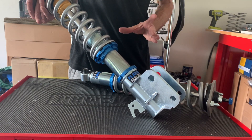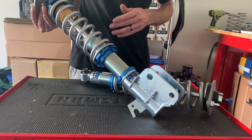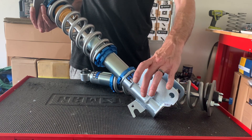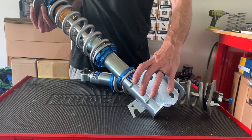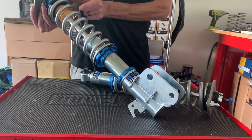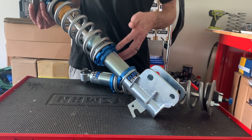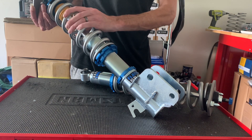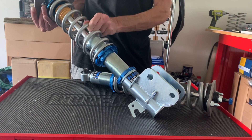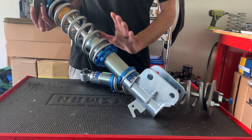One thing I want to go over is setting these up. When you get them out of the box, generally there's a yellow band on it because the assemblies are long and don't really fit in the box well, so we have to compress them down. To do that, we have to take preload off. This spring usually has a gap, so you have to adjust the spring collar and move it up to get it tight — but not overly tight. As you can see, I can move it because it's loose but it doesn't go up and down. That's zero preload, so keep it there.